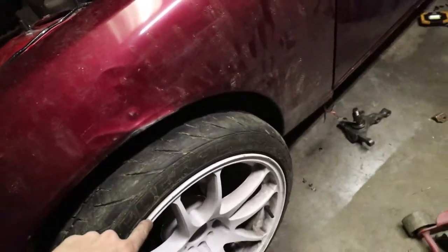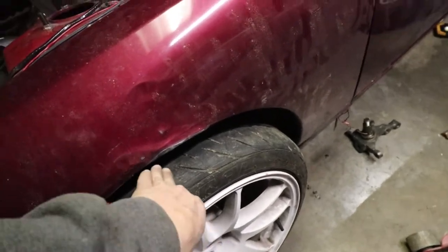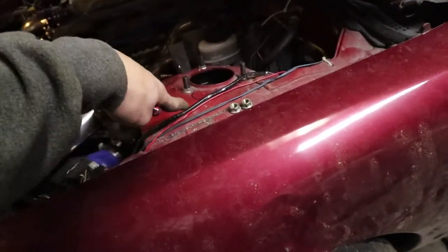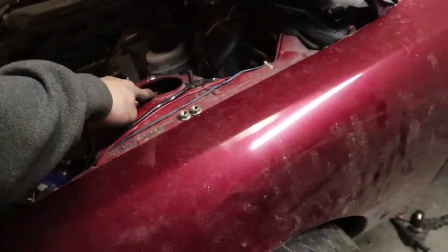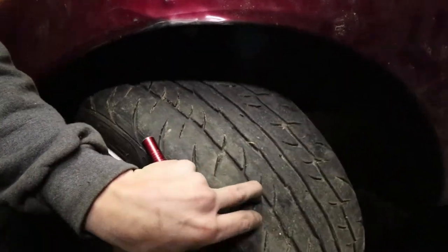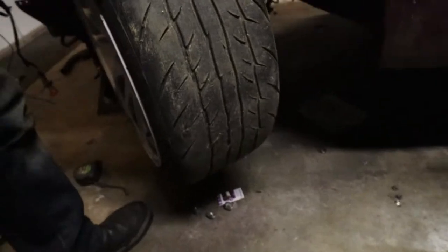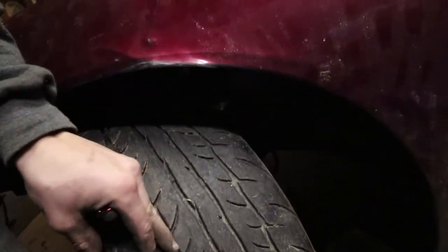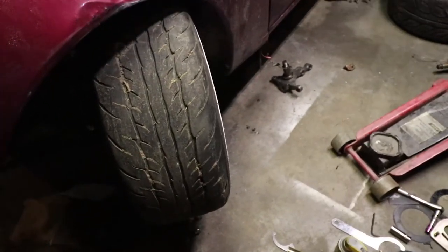So I got this all on. It's all adjusted. The camber is all the way in on the bottom side and all the way out. It's maxed out on this guy. I chose to go forward just because that's how Pat had it on his car last year. But if you look here, I got about 4 degrees of camber. I just checked it. And when you turn, you can see, I don't know if you guys can tell, but the tire is just about flat. It's got just a touch of camber, and then you go this way and it's pretty dead nuts flat.